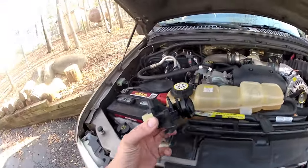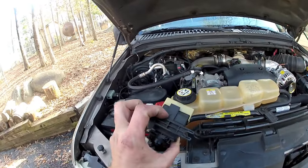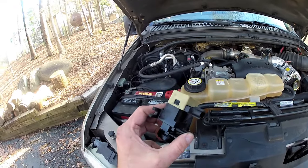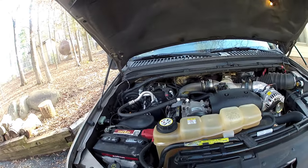Come to find out, the offending part is an unsuspected one — it's this piece, mounted right here by the vacuum. Here's the old one. It is called a vacuum EGR solenoid. It's about $88 at your Ford dealership. That component installed, and bingo, everything worked like brand new.